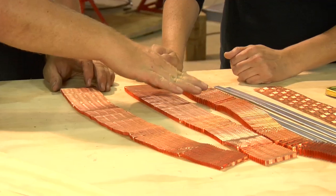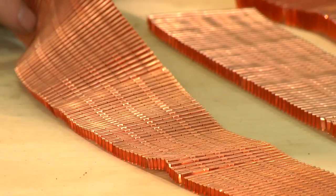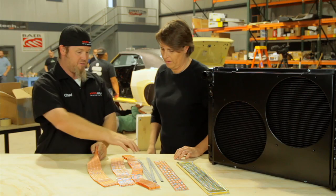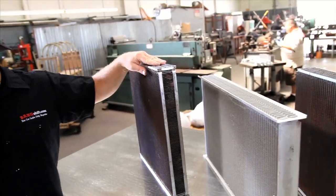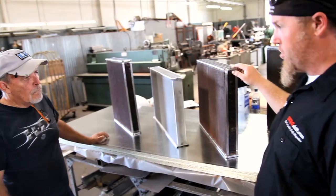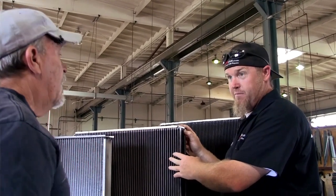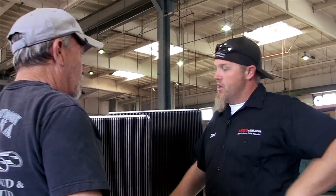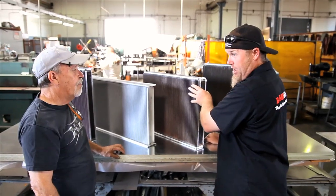The difference between the standard and high efficiency core is roughly half inch versus three eighths tube spacing. The next level, the Optima core, is five sixteenths. That puts more tubes across the face of the core and more heat transfer points per inch. This is a four-row with a half inch fin, and this is also a four-row but with three eighths, which became the standard after '88. It allowed manufacturers to go from a three-row down to a two-row with this fin and get the same temperature drop. Going from a four-row with a half inch fin to a four-row with three eighths gives you about fifteen percent more cooling capacity.